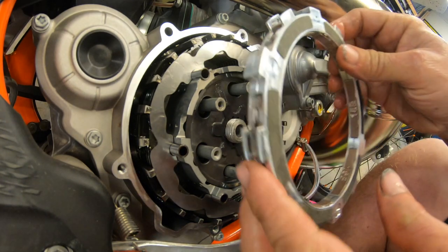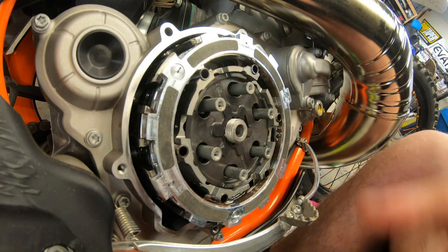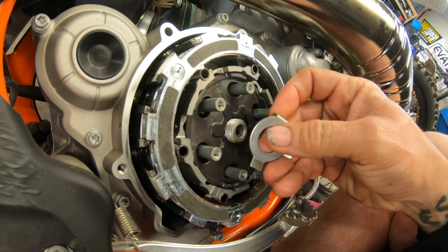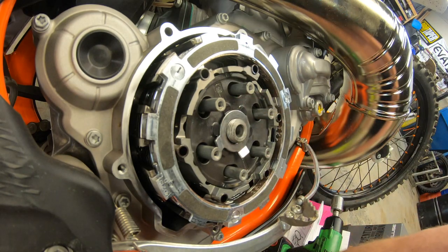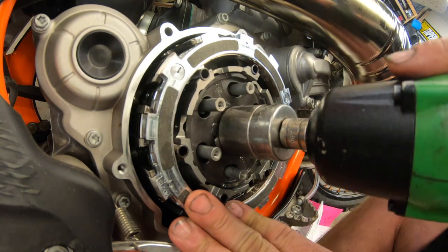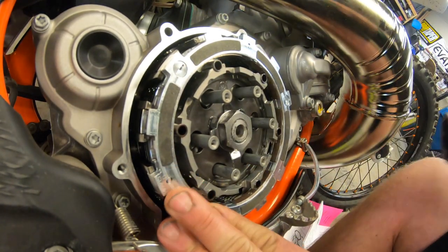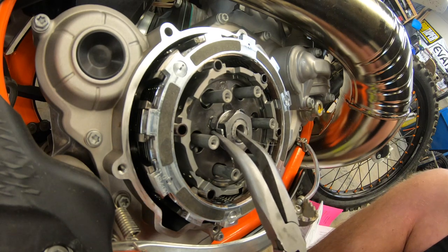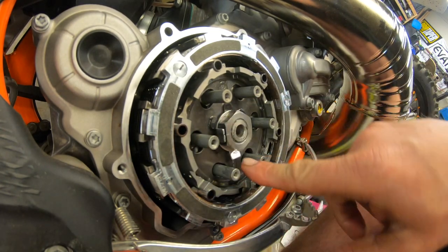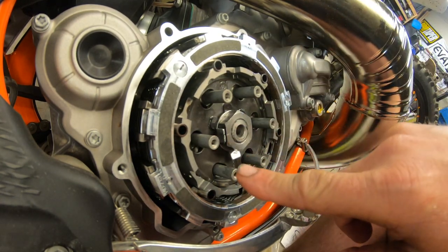Take our expanding ring — it goes in as if it were a friction plate. Once you get it all in there, put our nut back on. Recluse is kind enough to send a new locking washer — put that on with a little bit of Loctite. Always start it by hand, then push down on the stack to hold it in place while tightening. If you bend just one tab, that means if you ever take this back apart, you can bend it back without weakening it.